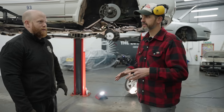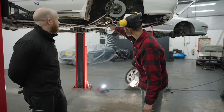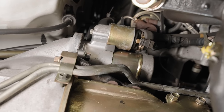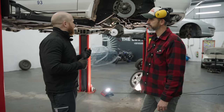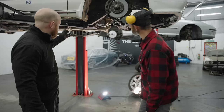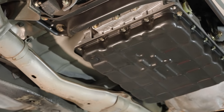Just stopped for a little break — good for your arms and your respiratory system. It's amazing the way it's picked up the bright work on the fasteners, castings, and brake lines. And it hasn't damaged any of the plastic brackets. Nine times out of ten you can do a clean like this without any detrimental effects. Everything uncovered — the grease nipples, the transmission pan — is perfectly dry. No problems, no leaks, no mist of oil. All the bolts are as new.